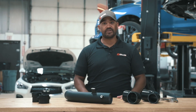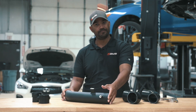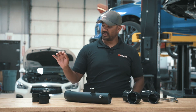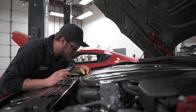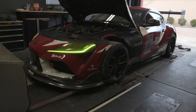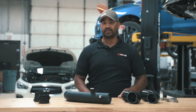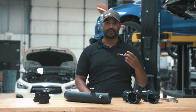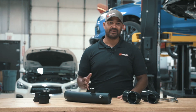So the charge pipe is actually a pretty simple part in concept. You have your tube, you have silicone couplers, clamps, and flanges. A lot of the work with this was actually just getting it to fit and be a full three inches with smooth tapers from the turbocharger up to the intake manifold. Back in the day we had all the room in the world, but now with modern cars there's a lot of extra plumbing, tubes, ventilation, evaporative emissions controls — all those kinds of things that kind of get in the way.